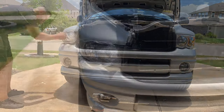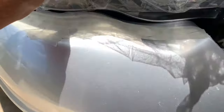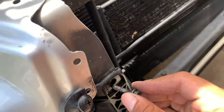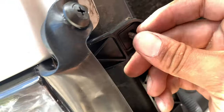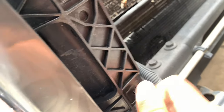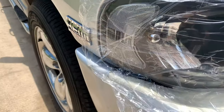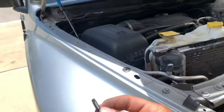Now I've got the headlamp in place. I kept the plastic wrap around it just so putting it into the bumper and fender area wouldn't scratch anything, and the tape is still on the bumper too. I'm going to clean that up but first I'll start by threading all the screws back in by hand. Anytime you tighten something you never want to crank everything down immediately — bring them all in little by little. Since these two are the easiest to reach I'll start with those, then put in that bottom bolt last. I'll need both hands for that one.